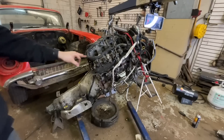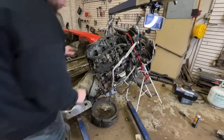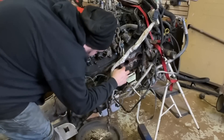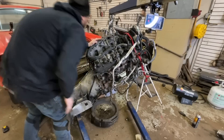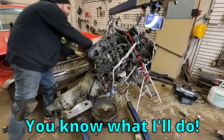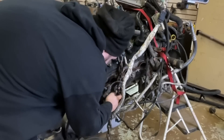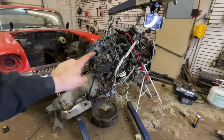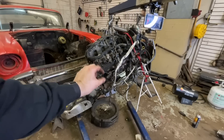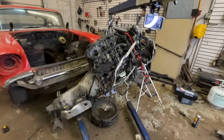Oil pan has been changed — great news, I don't have to get under that scary death trap anymore. I did break a couple exhaust studs, but that's pretty natural with an LS. I'm debating whether to do it now or in the car. You know what — I'm probably going to put it down on the ground and then do them. The way to do it is you weld a nut on the broken stud and then back it out. It looks like there are four or five that need done, which is very upsetting.